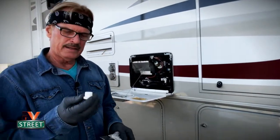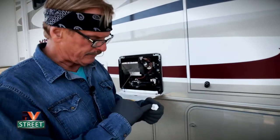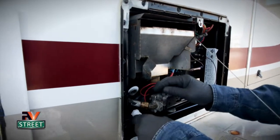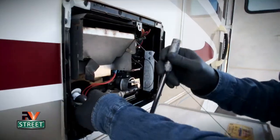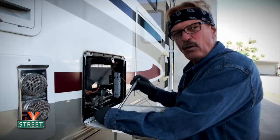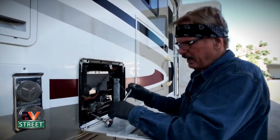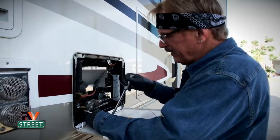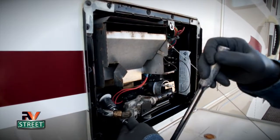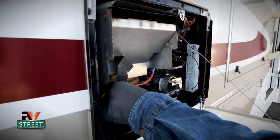The next step is we're going to put in a new plug. These come two to a pack and are available in my Amazon store — they have a built-in safety feature with the hollowness inside, and they do not need Teflon tape. We go ahead and put this in and tighten it up with our socket. I reused the old plug just to cook the vinegar overnight — now I'm putting in a new plug because this one's going to be in here for six months. There's no torque; we just snug it up. Those threads are tapered, nice and tight — it will not leak.